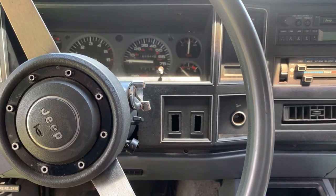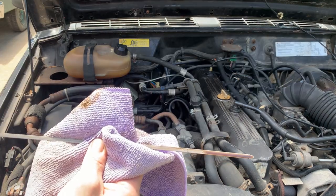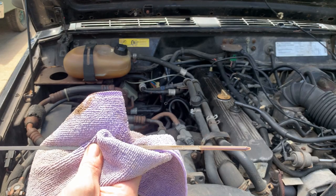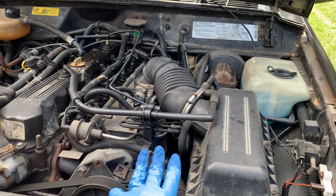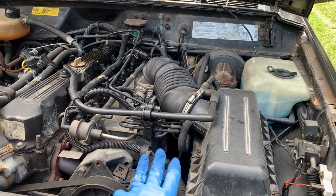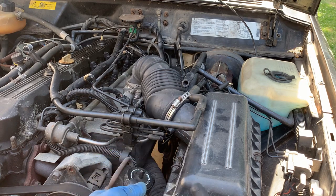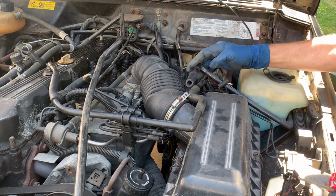There's a pop, so we're definitely getting backfires — lack of combustion somewhere. I'm just going to keep tracing the problem. I'm not familiar enough with these Renix motors to know exactly what's going on — could be something really stupid. There's no milkshake in the oil and it's not overly gassy. Could be a bad head gasket, but with this cooling system you really don't have direct access to the radiator. I need to try to replace this large vacuum line — basically nobody has it locally — so I might have to make a custom part.